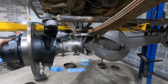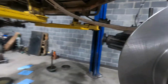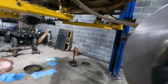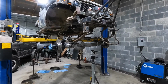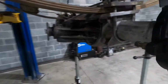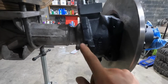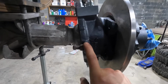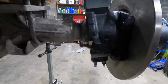I just got the knuckles on and this old steering bar on, just so I can put a tire on it. Actually, probably put both tires on it, put it down on the rear axle and jack stands, put the weight on it, so then I can figure out shocks, mock the shocks up, make shock tabs, and then also I got to do the shackle stops, steering stops. I did have to steal 3 of these out of my other axle in my other garage because I only had one of them, which I hate robbing parts out of complete axles, but I needed them.